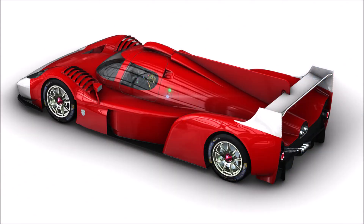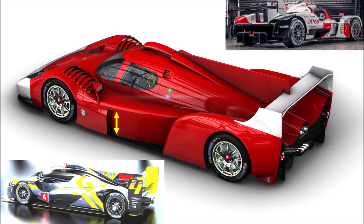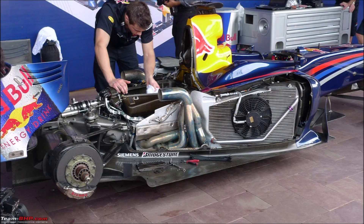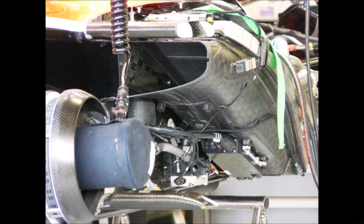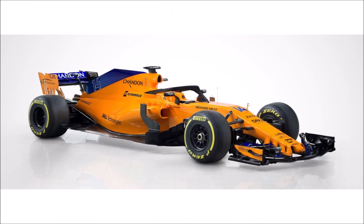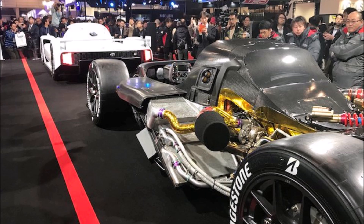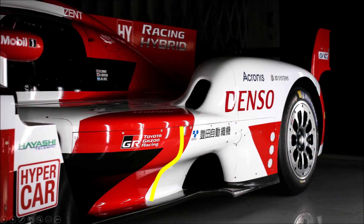A nice little detail of the 007 is that the cockpit outlet is also the door handle. If we look at the side pod, we note that it's very wide and high compared to Toyota and ByKolles. And if we look at their pictures from assembly we can see why. They have a standing rectangular radiator pretty far forward in the side pod, and this design reminded me of pre-2011 Formula 1 cars. From 2011 onwards Formula 1 teams changed to lying radiators with a bespoke shape which enabled more extreme undercut designs to bring more energy to the back of the car and to create more downforce. But this is an expensive solution and this is exactly what Toyota did — it's the reason why they can have such a large undercut. The Glickenhaus on the other hand uses an off-the-shelf radiator which is a lot cheaper.